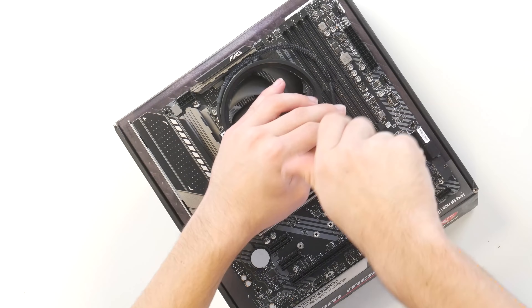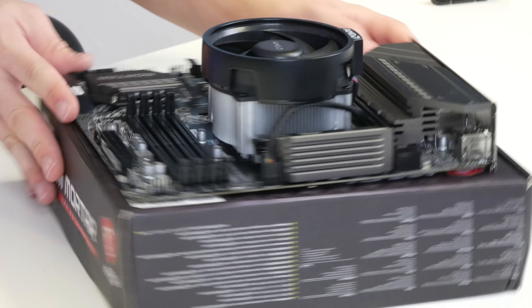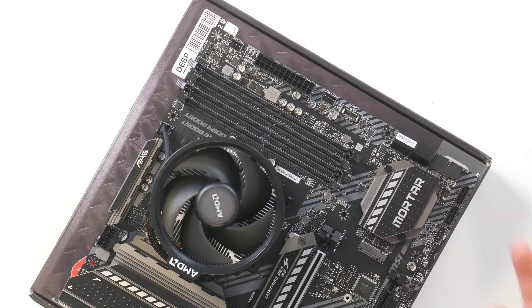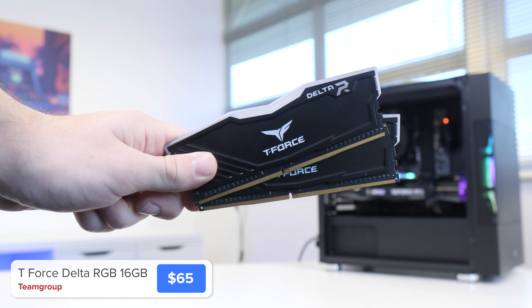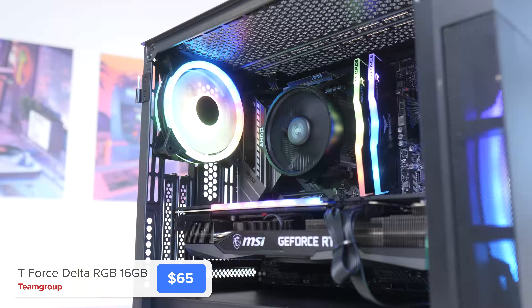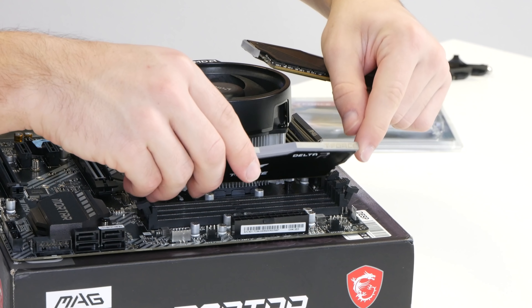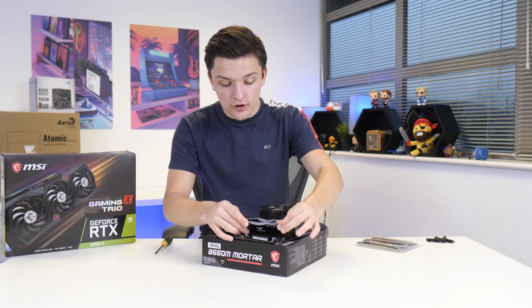The final step with our cooler is just to plug up this four-pin PWM fan cable to this port right here on the top of the motherboard. The next step is to install the RAM. To do this we need to pull back the second and fourth clips on the second and fourth DIMM slots to make way for our TeamGroup T-Force Delta RGB memory. Available in 3200 or 3600 megahertz kits, this is consistently some of the cheapest RAM on the market, plus this one's RGB which can never hurt. Line up the notch on your RAM DIMM slot with the corresponding notch on the RAM DIMM, apply even pressure to both sides and we're good to go.